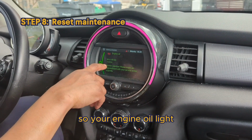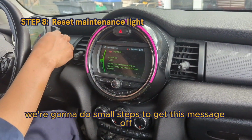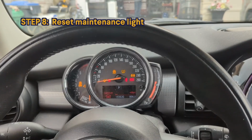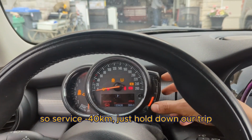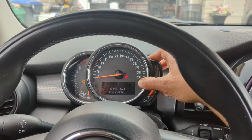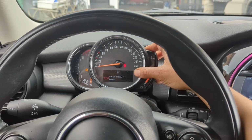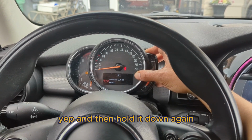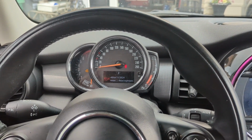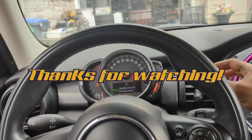So your engine oil light, your service notification. To remove this, we're going to do a few small steps to get this message off. So service minus 40 kilometers. Let's hold down our trip. Here we go. And then hold it down again. Yeah, and then hold it down again. Then it's going to do a reset in progress. Then you're done. Thanks for watching.